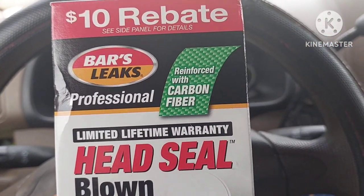What made me want to try this head gasket stop leak is that whenever I would switch the plugs around, I would notice that cylinder number three would have a little steam coming out of the plug hole whenever I took the plugs and the coil out. Whenever I would do that, there would be a little bit of steam coming out of that specific hole — maybe cylinder number two as well — and generally that's where the misfire would start on cylinder number three.